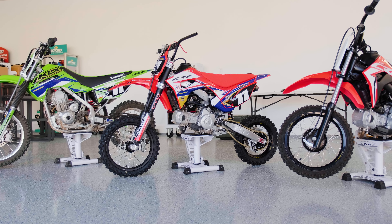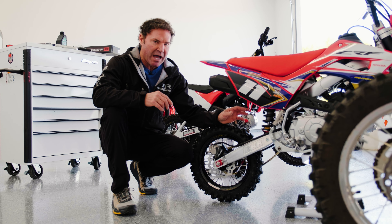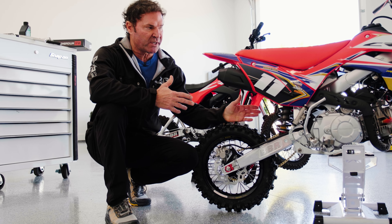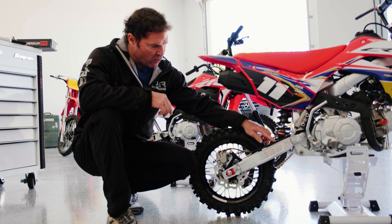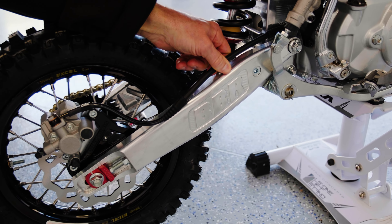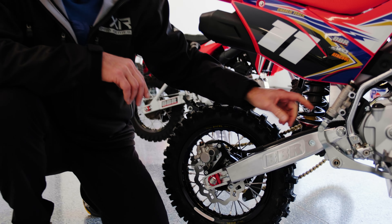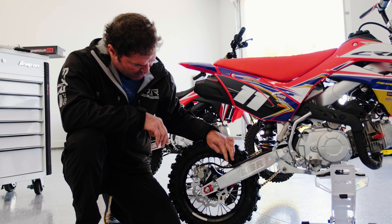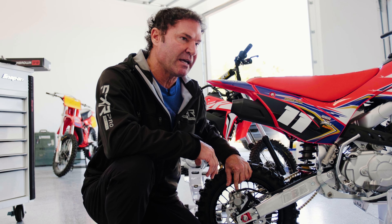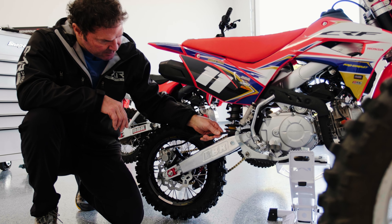We'll see once we test it. Even though you're buying these kits, you still have to fabricate or find parts to make it work. This would work fine with the stock wheel, but since we're doing an all-out build we might as well put a rear disc on — so it has this hole for it. We just need to get a mount to have this cable pulled back a bit so it comes off the motor. I believe the caliper and master — the whole system — is a KX 80 rotor, and we had to have this brake line ordered in a custom size.